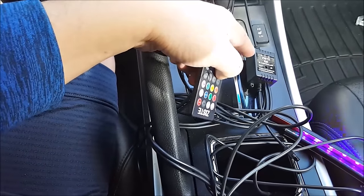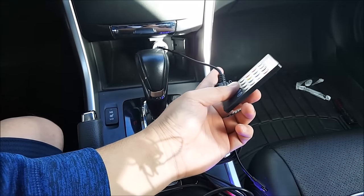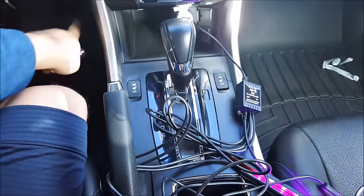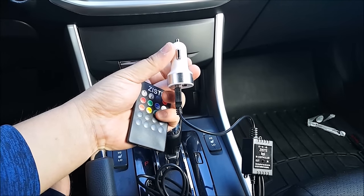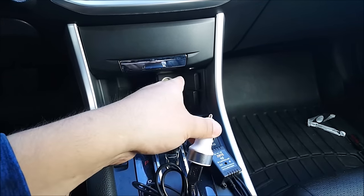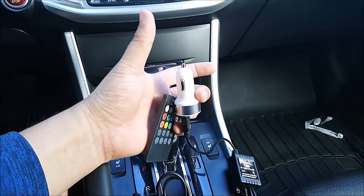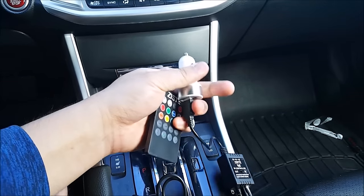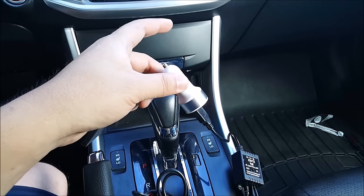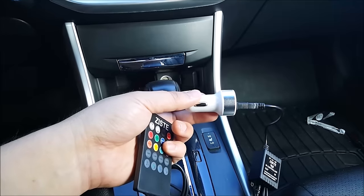Because of that, I'm going to purchase a longer USB extension cable so I'm able to route the receiver somewhere up front. I'm also going to hardwire this into my vehicle so it's not drawing off the charge port. They do sell an adapter — a female plug that comes with two wires — and you can connect those two wires into your fuse panel on the driver's side using an add-a-fuse.